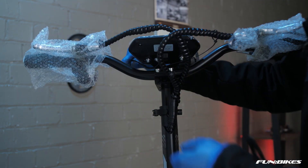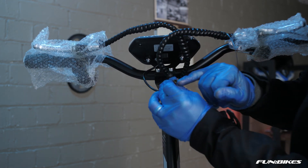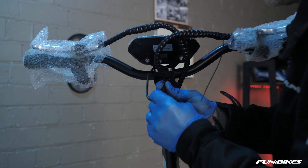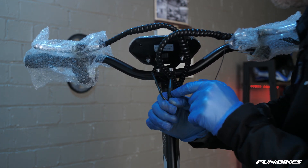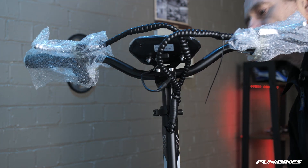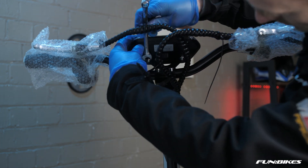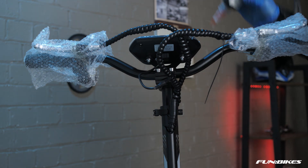We then need to connect our computer into the black connector coming out of the loom. You will see there is a slot in it to align with the plastic pin inside so it always connects in the correct position. There are also arrows on the outside of the bracket which point towards each other so you know you have it in the correct position. Then using the 10 spanner make sure the computer is tight — do not over tighten, you are literally just making sure it is nipped up — and then apply a small quantity of stud lock to the end of the threads.